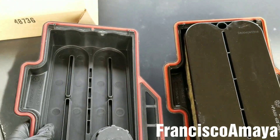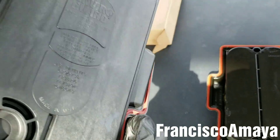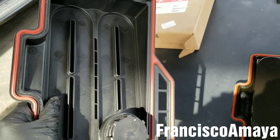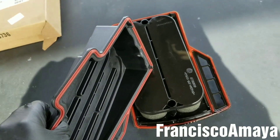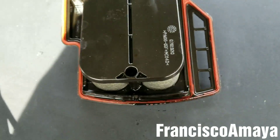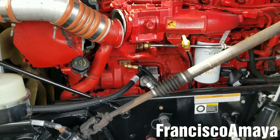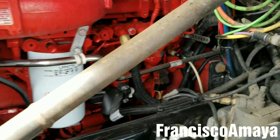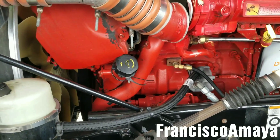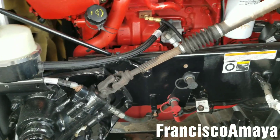In the meantime, you want to get some money to fix your engine. I'm making this video because I know many people don't even know about this, and it's going to help a lot of people — because people are having so much trouble with this crankcase filter since the thick crankcase filter generates a lot of pressure. With this bypass filter, you're going to fix that problem and save many different components of the engine, since high crankcase pressure is the main reason why turbos and main gaskets — like front and rear gaskets — go bad. Especially the front cover area, which goes bad very commonly because of high crankcase pressure.